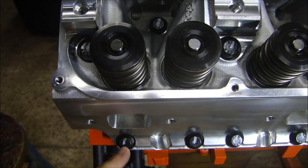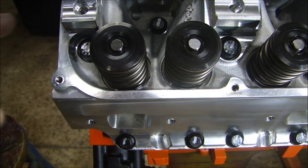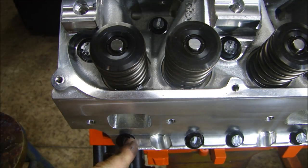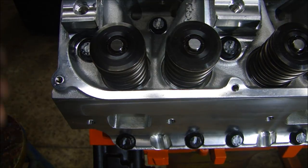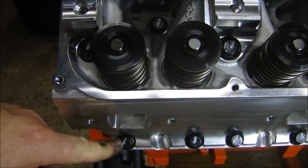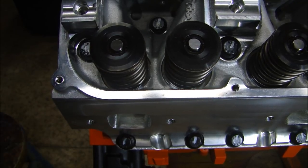Now all the bolts are re-torqued. They went from 12 o'clock to just a little bit between 12 and 1 — some to 1, but looking at all of them, they're all about the same, roughly 12:30. So it's about halfway between 12 and 1. Putting ARP lubricant under the head of a bolt does not result in a huge change in where the bolt rests when you go to 70 foot-pounds of torque. Now, what is interesting is what the breakaway torques were. Let me take a quick look at that chart.